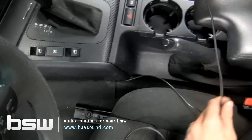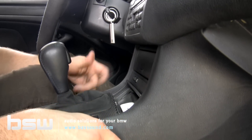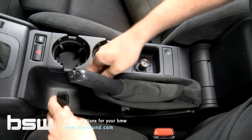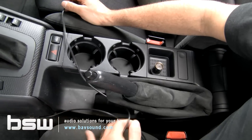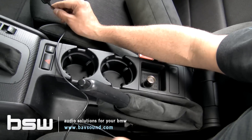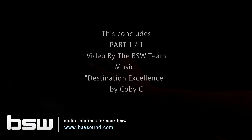Now sitting up in the seat — at this point you've got plenty of cable and can do whatever you want. You can route it into your center console. If you've got one of our spec docks, this would plug into the female connector on the spec dock which lives in the ashtray. If you want to bring it out at the emergency brake boot, tuck it back up through here and leave maybe a few inches of cable exposed — put your iPod or iPhone right there. There's plenty of room to keep the cable hidden. That's a super quick way to do this install for our most basic kit with iPod or iPhone integration. That wraps up the install here in our 1999 through 2005 BMW three series sedan. Thanks for joining us — we'll see you next time.